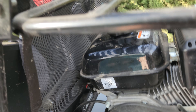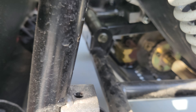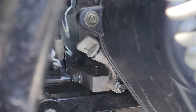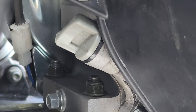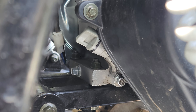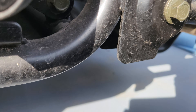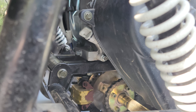Down here it is pretty difficult to get to — I'll zoom in a little bit. That's the dipstick to check your oil level, and you've got to reach in there. One thing that always happens is as soon as you unscrew it, the oil hits the ground. So we're going to put some shop towels down for the next video and go ahead and check that oil.